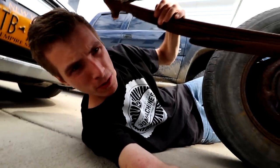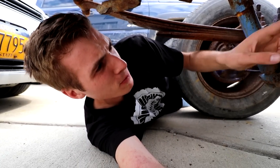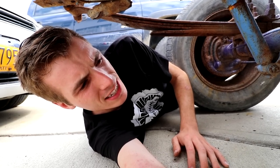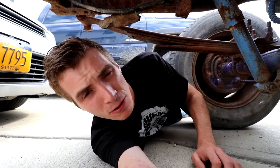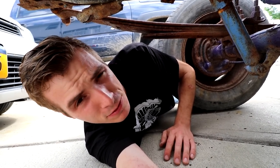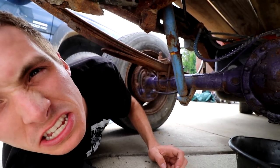Jake and I are supposed to work on this thing tomorrow. This is going to be a little bit of an issue — you notice how there's no fill plug here? It might be right in front of me on the front part of the differential, but I don't really see it. So instead of waiting on Jake and waiting on tomorrow to take this thing off, I think I'm just going to take it off right now. And if the thing is a rusty, crusty thing, I would like to know that before going into tomorrow. Because if we need to get a new one, I'd like to know where there's one available. Let's take this thing off and start the draining process.